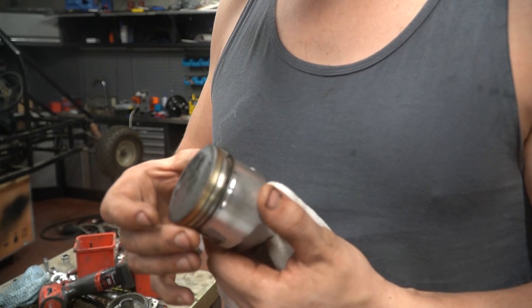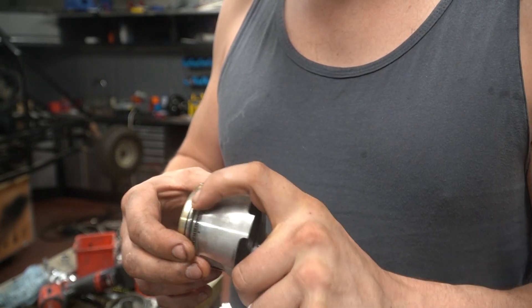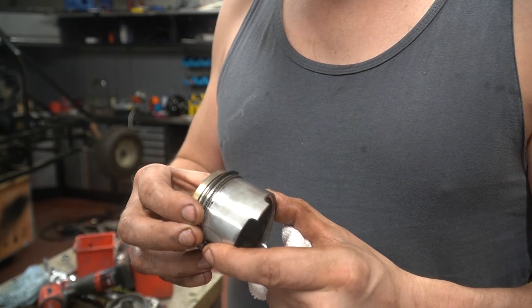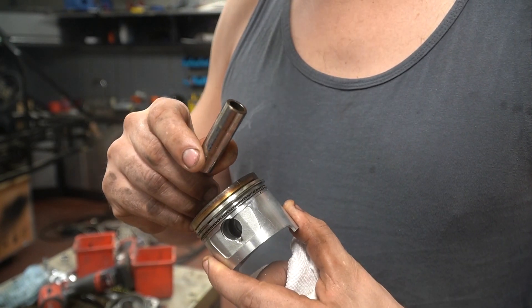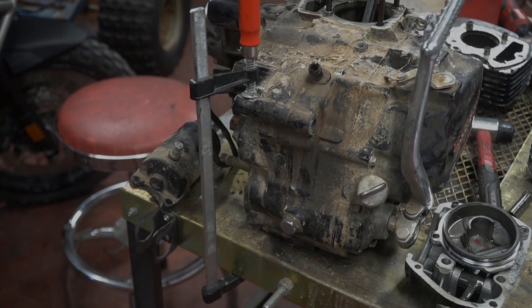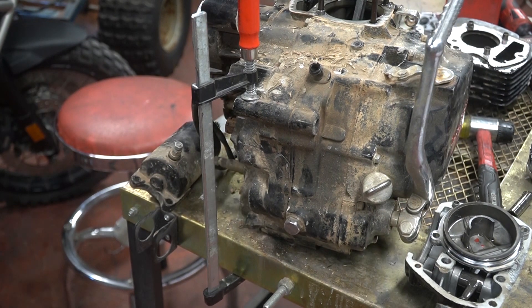Now the same measurements apply to the bore as the piston — just opposite, obviously — and you would again have to measure them at different points if you plan on reusing them. Contrary to popular belief, reusing them is often a better idea than buying new ones. There's also the addition of the gudgeon pin bore — you'd measure this along with your pin, then compare that to your small end bearing on the end of your connecting rod. At this stage it's probably a good idea to make sure your engine is mounted in a perfectly safe and secure way that isn't going to go anywhere, because the bottom end is where all the oil is and as a result things get messy.